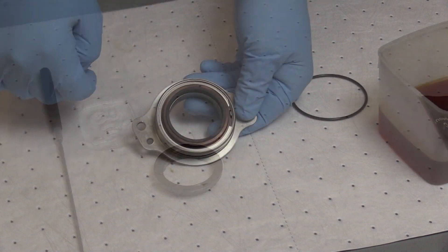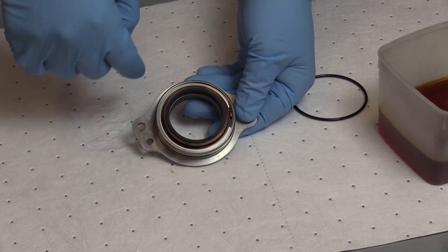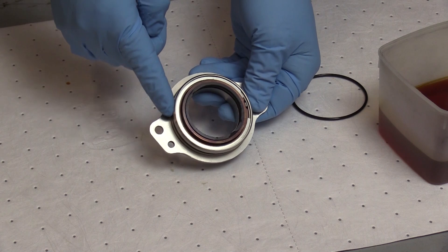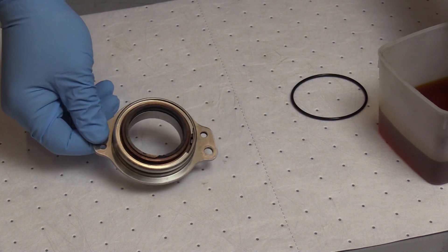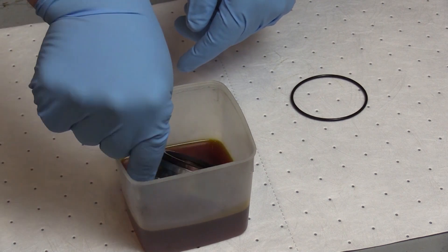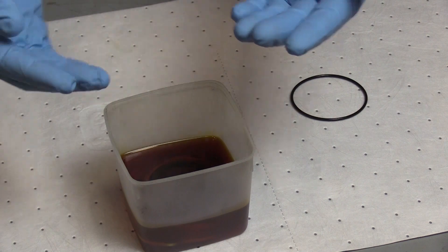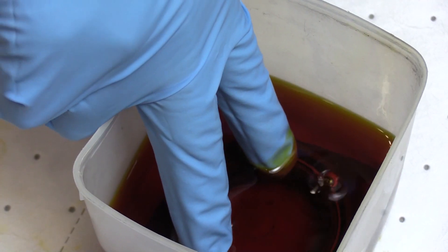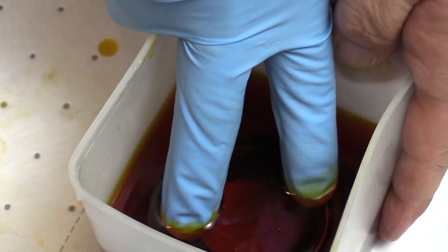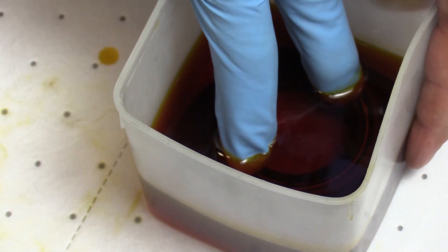One of the things that shortens the life of a carbon seal is insufficient lubrication between the spring-loaded carbon of the seal and the housing itself. So this is another new part of the procedure — what we're going to do is completely submerge that carbon seal in engine oil, carbon seal side up. We're going to depress it a few times — it's spring-loaded — and press it until all the air bubbles come out.